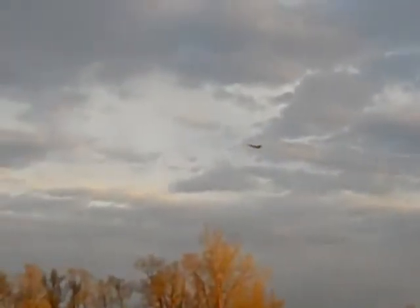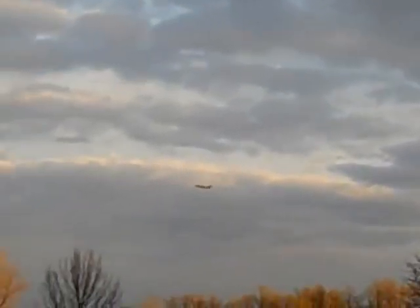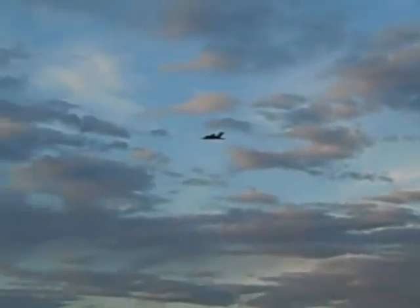You can see it climb out going with the wind. Now we're going down tailwind, nice and fast. Singing along real good now. I think the answer is going to be this 11.7 prop on a 3-cell battery. We'll have to test on a 5-cell battery, but I'm thinking we're going to keep the 11.7 even on the 5-cell. At three-quarter throttle it stays in the air pretty good — I'm actually impressed.